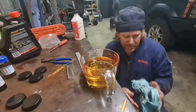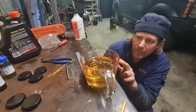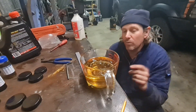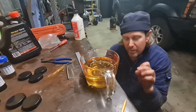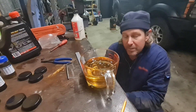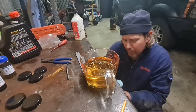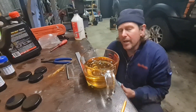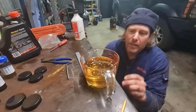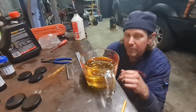So for the rear diff, we're talking about 250 mil more to fill it up from 8 mil below the filler plug to spill level. So there's the difference on the rear diff. The front diff — I've just measured that as well. That is 10 mil below the level plug, and the extra required to top it up is 150 mil.